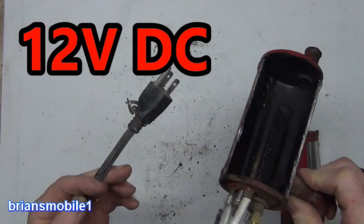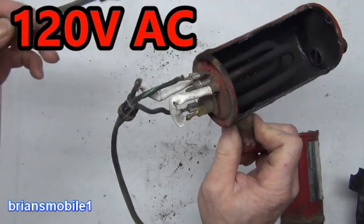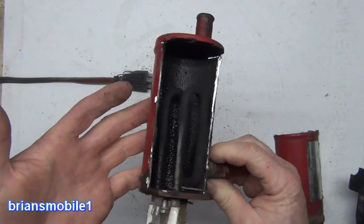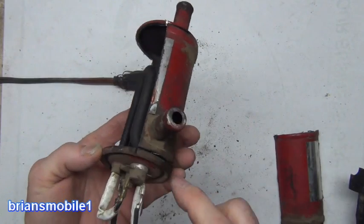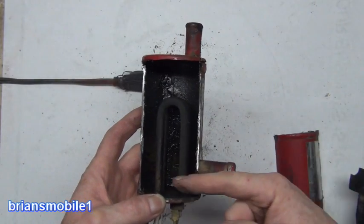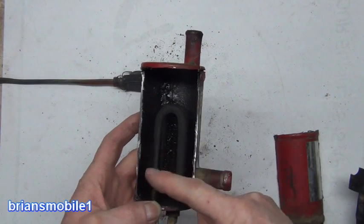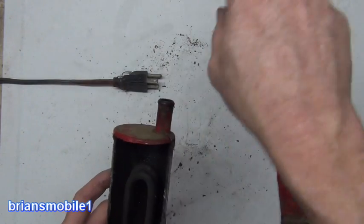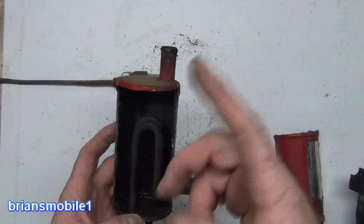Look at our plug — it's not 12 volt. It is alternating current. We've just got a tank with a heater in it. There's no pump, no push, nothing like that. You've got a thermal switch and a return where coolant can go into the bottom of it. It gets heated by this heat coil and then it just goes up through here because heat rises. So you've got a constant swap of coolant.